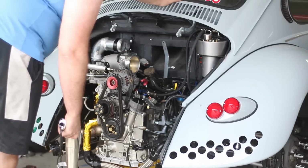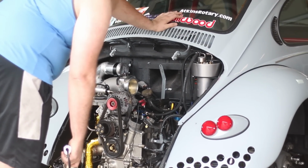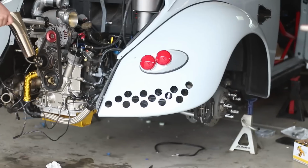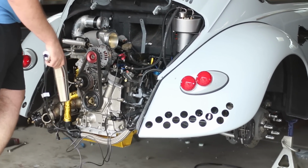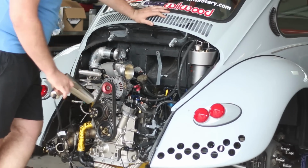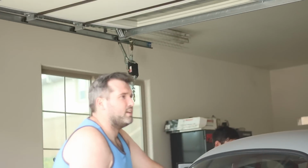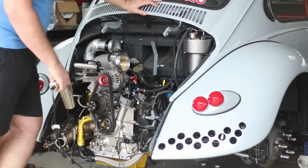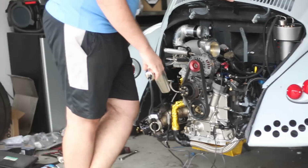Is it like a regular combustion, like 10? Yeah, thereabouts, like 10 degrees advance. And like static. So the rotary... It's like 10 degrees at idle and like static 15 everywhere else. The rotary doesn't change that? They don't like a whole lot of timing. Static 15? It's just like a regular tune for these cars? That's the general gist I've seen. That was from what's his face from Haltech. He did a video about it, and apparently what you want is about 15 to 20 maximum, because detonation on these things is a death sentence.